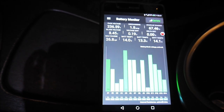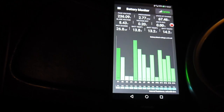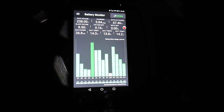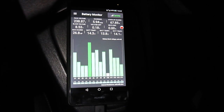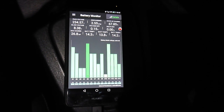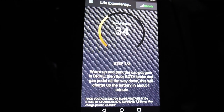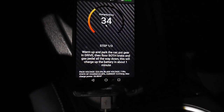This is Dr. Prius — it feels like a really good job, but I'll do some tests a little bit later after everything is fully back in place. The battery is looking really good. I do have a slightly low voltage on cell number 10, but it's very close to the others so it shouldn't be a problem. First phase: charging the batteries. I'm using Dr. Hybrid — the voltage is going up to 223. They are accepting the charge.